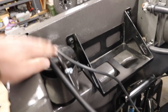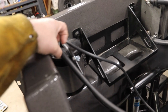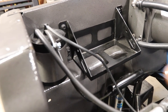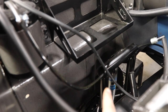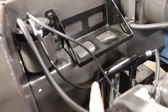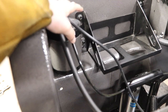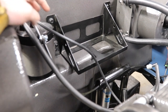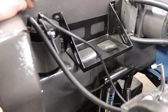I also got my evap canister hooked up. There's not that much information on putting an evap canister in because most guys just take them and throw them in the trash. So let me walk you through how this works. First, the line from the fuel tank — that's this plastic line that comes from the fuel tank. Your fuel tank vent comes up. It's got a rollover valve back at the tank. It comes up into the evap canister, which captures those fuel vapors.